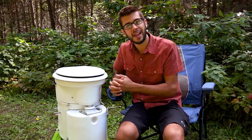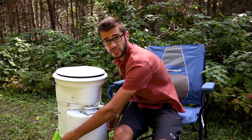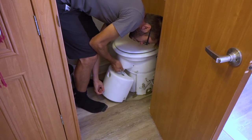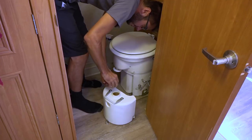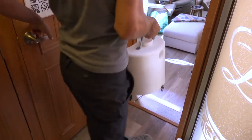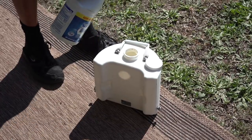You're going to need to empty this toilet, and the first thing you'll need to do is empty the liquids tank. With two people using it, we have to empty it just about every single day. The design makes it incredibly easy — you loosen two screws on the side, grab the lower ring and the handle, tilt it out and forward, and it just pops out. You can walk the tank outside to a dump location. We found the liquids tank can smell more than the solids, so we frequently pour some vinegar in it to break up crystals, or sometimes a little bleach to kill organic smell.